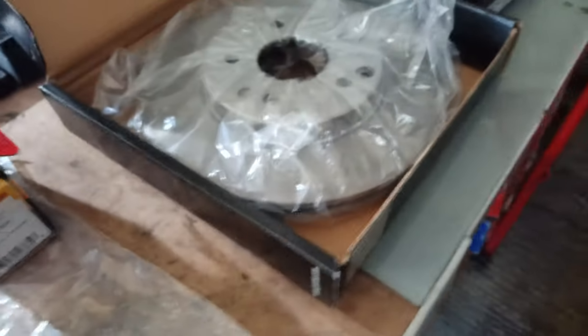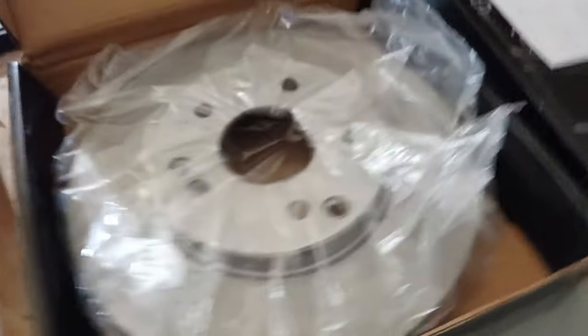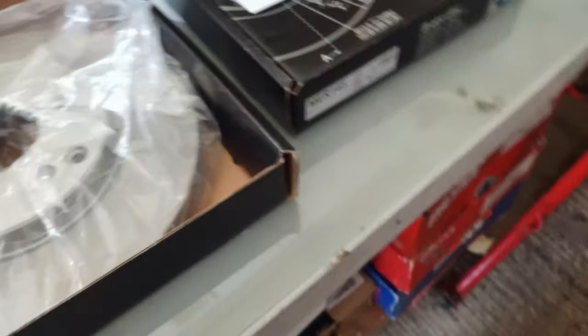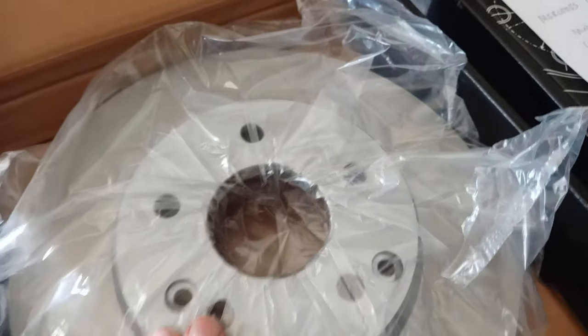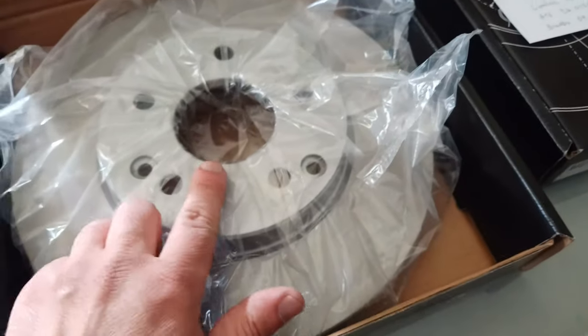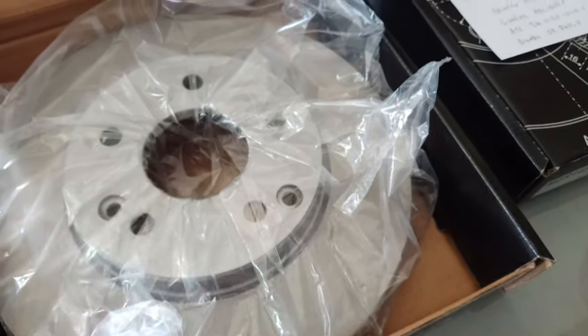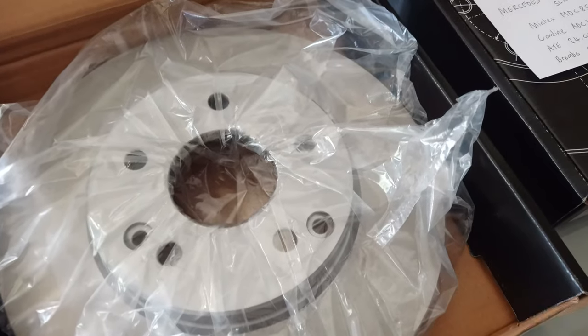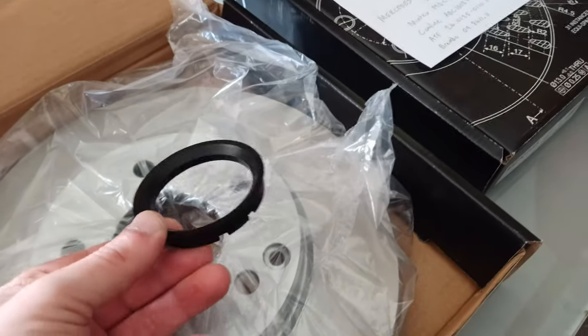The disc is from a Mercedes C-Class and they are 25 millimeters thick. These are just cheap discs I bought to test it out, but this does need to be drilled for the 4x100 stud pattern. That's no problem. A centering ring will also be needed for the hub — again, easy to get made. You could even use a plastic wheel spigot ring like those commonly used for alloy wheels.